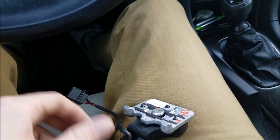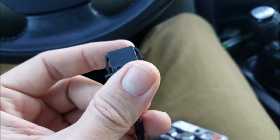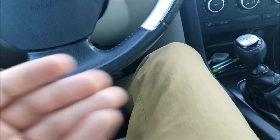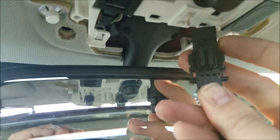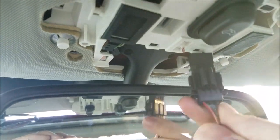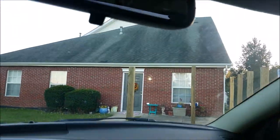The older generation body style, the curvy one, 2003 and onward to around 2006, should have the male connector if they have a connector - not all years have a connector. If it's the 2007 body transition year, that should switch over to this female connector. Same thing with the mirror. Once you expose this connector and verify everything looks the same, the only other thing to do is plug it in. Go ahead and unplug it by pushing in these two tabs so it releases - you don't want it hanging by the plug.